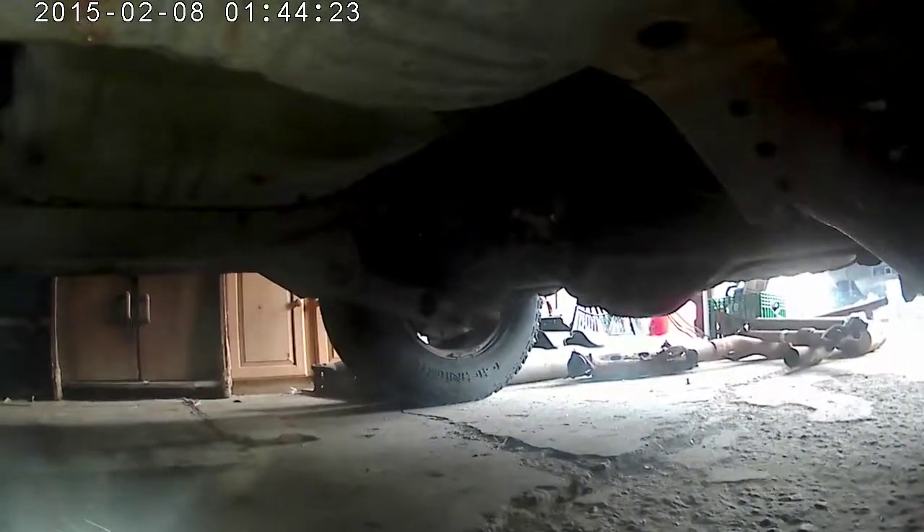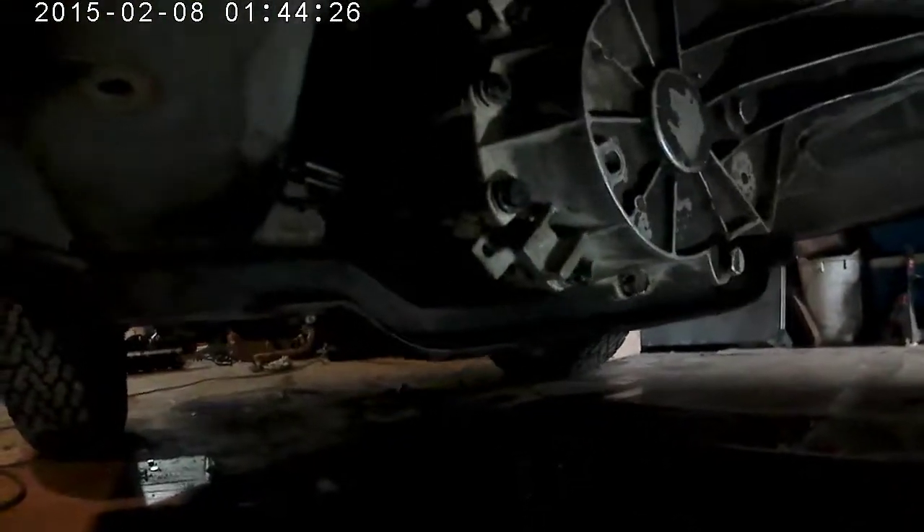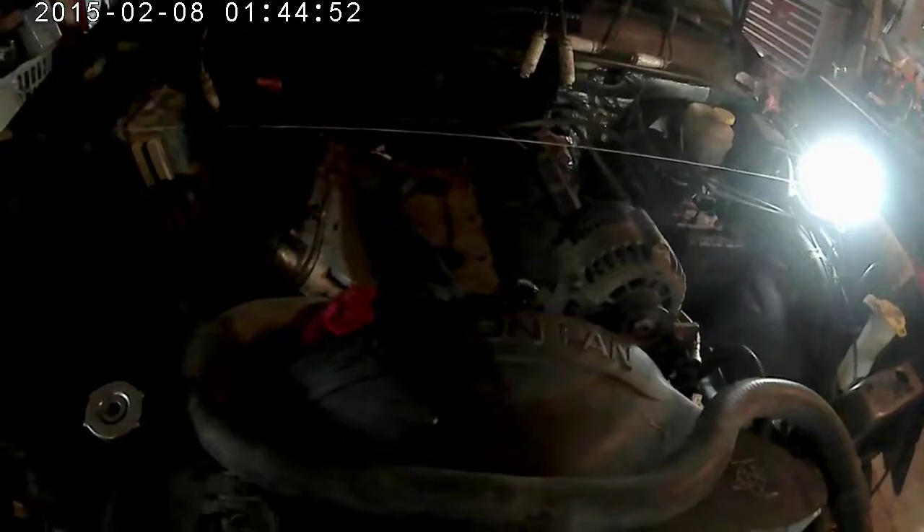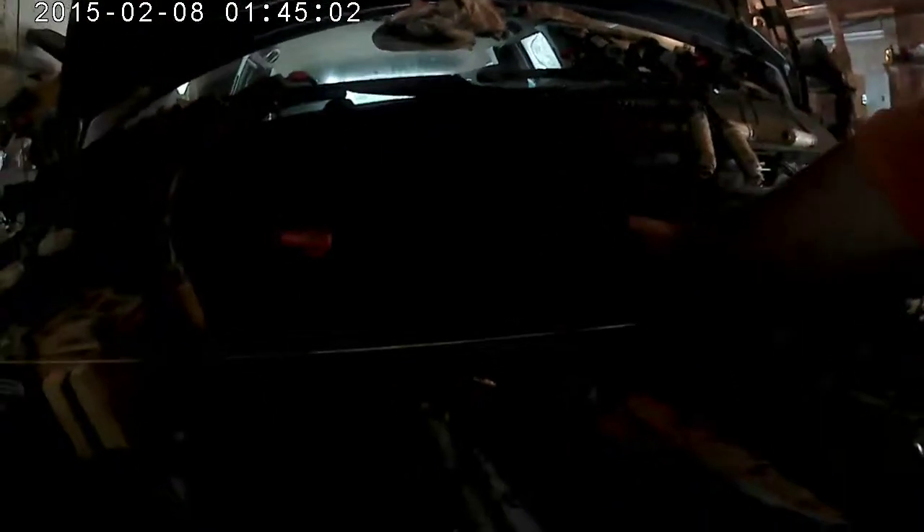I suspect we're going to blow up the rear end first anyway. I have just enough hood clearance to clear the alternator and truck intake with no modifications, which is good because I couldn't lower the engine at all. I could slide it back a little bit, but it hits right where the MAP sensor on the truck intake is — hits right here on the cowl. I couldn't get a swing with the hammer to really dent that at all. It's not a big deal.